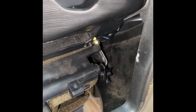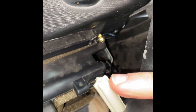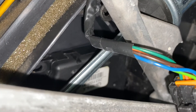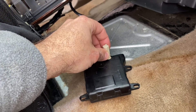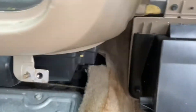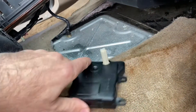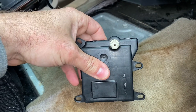I got my new unit here. I'm just going to drop it right down in this hole and try to just work it around so that I can get this tooth to line up and then bolt it up. I was able to get this new unit in place - I slipped it in. Now this male piece, you've got to slip it in. It's pretty tough. You have to kind of move around this vacuum actuator rod and really just work around the unit to fit behind it before you can actually insert it into the female hole down there. This is a tooth that has to be aligned a certain way.